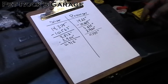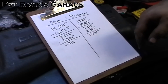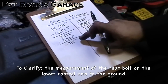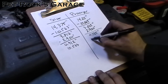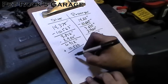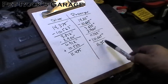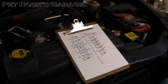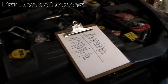While doing these measurements, the distance between the floor and the center of the wheel is not going to change — it's going to be the same no matter what you do. What's going to change is the distance between the ground and the rear bolt in the lower control arm. So to find out what measurement to shoot for, add the spec delta to the current rear bolt measurement: 10.563 and 10.625 give you target values of 11.475 and 11.35. Before you take your new measurements, bounce the suspension up and down again.